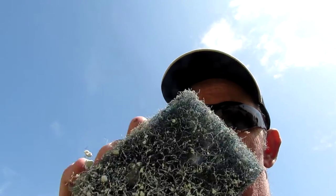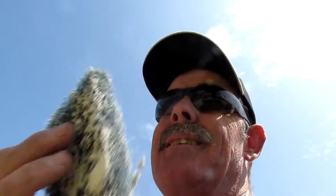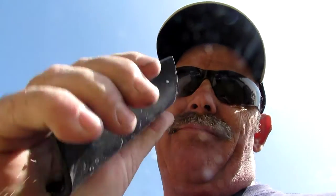Once you get your section done, go back with one of these thick scratch pads and knock down all your putty marks — the lines from applying it. I've been using this rubber squeegee thing for body work sanding, flexible — I use this for applying the goop. Then you knock it down with this. Like 15 minutes from application, you start painting — good to go.